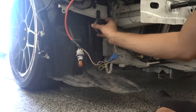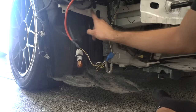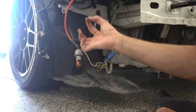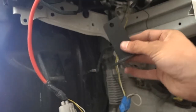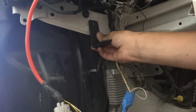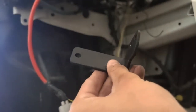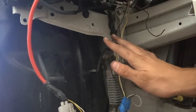The next step is to relocate what I believe is the horn to the already pre-drilled hole to the left of it. If you look directly across there are two holes — one higher and one lower. I'm going to relocate it to the lower one where two pieces of metal meet. Now I'll place the L-bracket — one bracket is L-shaped and the other is Z-shaped — into that hole and bolt it there. I don't like the bumps there that were meant to hold the horn and stop it from twisting, so I'm going to use a Dremel tool to shave them down for a smoother surface. This is not required — just me being picky.